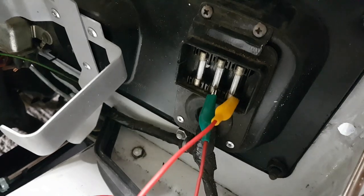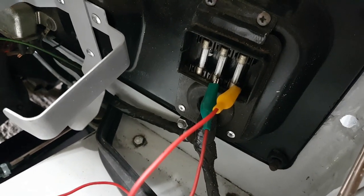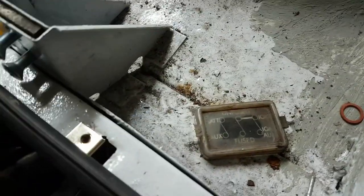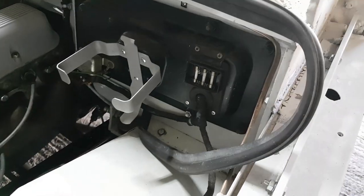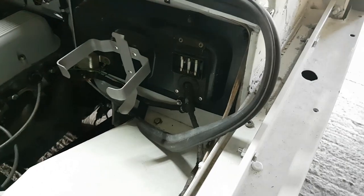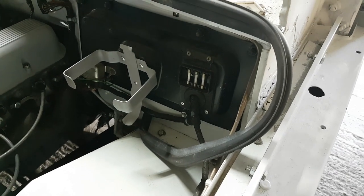Partly out of frustration and desperation, I've bridged fuses 2 and 3, because they're on the same circuit. I've bridged it on the fused side just to be absolutely sure. I'm going to set fire to something. And I'm now getting a circuit through to the ignition module. What I'm not getting, though, is where on earth those two white wires bridge anyway.